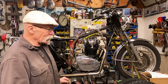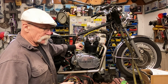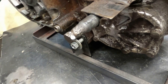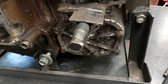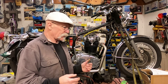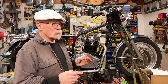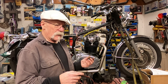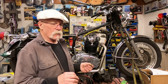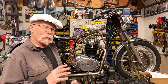There's a new motor in it. I got looking at the old one for a couple of reasons. The shifter needed to be replaced — the whole mechanism; somebody had welded on it and basically screwed it up, stripping the splines where the shifter would slide on. There were also a couple of oil leaks off the main seal on the crank, and leakage up by the valve cover caps on the right side. It looked like it had been burning a little bit of oil on the left bank.